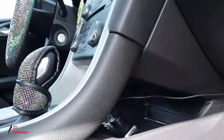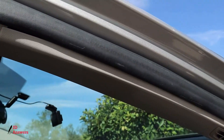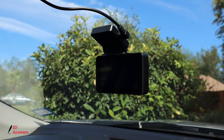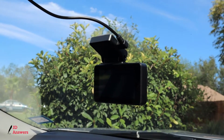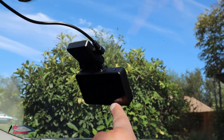Once at the end of the carpet, since the outlet is pretty much right in this area, go up into the center console area and push the wire in through that opening. Now we're at the point where we can just run the wire straight to the outlet. Simply run it and push it in there — there it goes. After installing the wire you'll see some slack; just pull it to the back and push it behind the carpet to hide all the slack. The front dash cam is installed with no exposed wires anywhere.